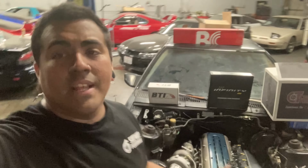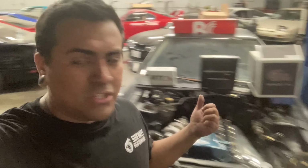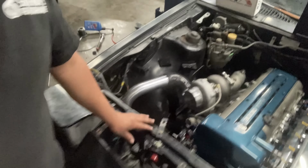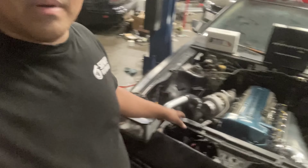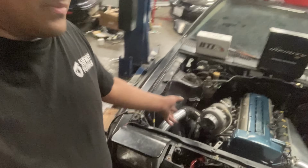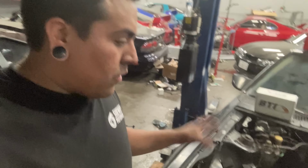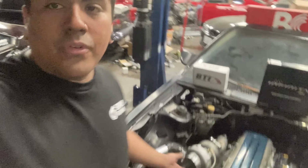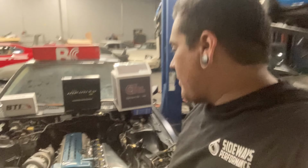So as far as next week and what needs to get done, we're going to need to finish the driveshaft, the throttle cable, and do all the wiring that we're going to need for this. I need to fab a custom radiator mount for the bottom. I've already mocked it up and put some rivnuts in the crossmember radiator support area to hold the radiator that I've already chosen. We need to put a serpentine belt on, get a few radiator hoses cut to make it fit, and put the shifter in, put the gear oil in, hook up the dash, and we should be ready to go.